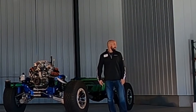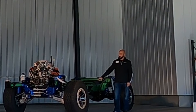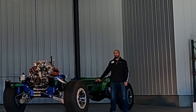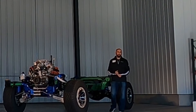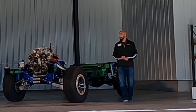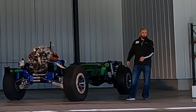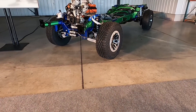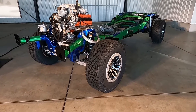At the heart of a beast like this is a solid foundation. The frame of the Ram TRX is 74% new. It started life as a Ram 1500 frame. We've up-gauged with thicker materials and up-yielded with higher-strength steel. When you look at the frame chassis here, you'll see black items for carryover parts. Everything in green is an example of that up-gauge, up-yielded material. And the items in blue are all new for the TRX.